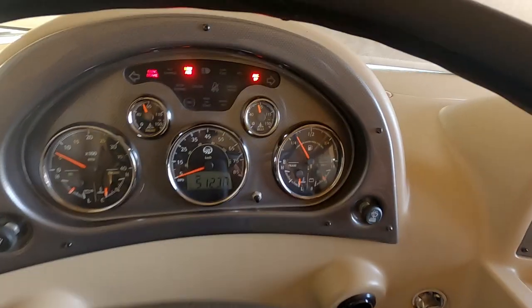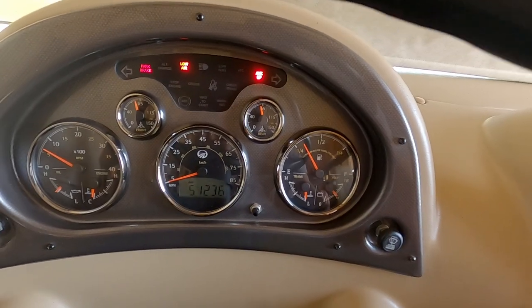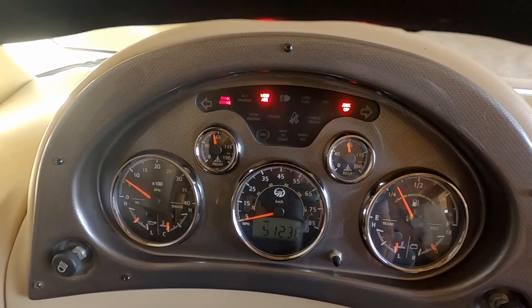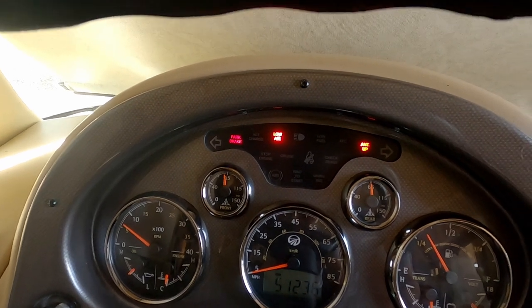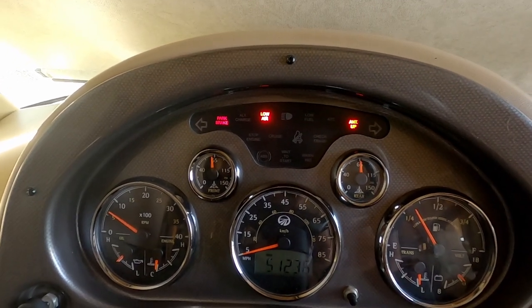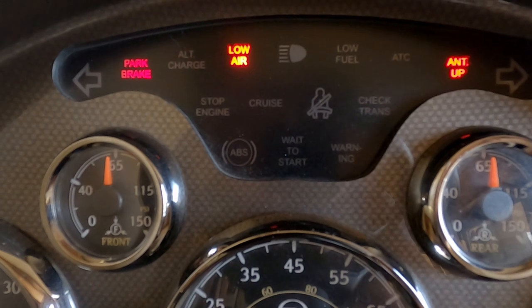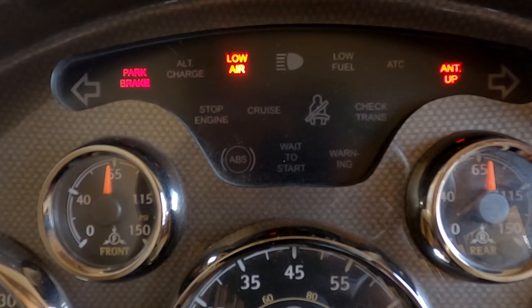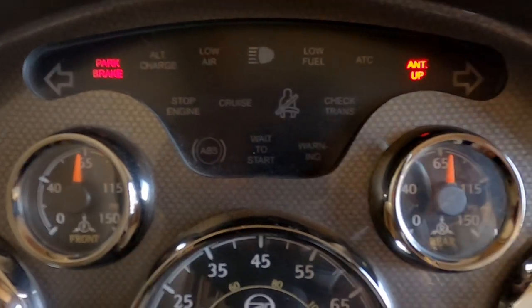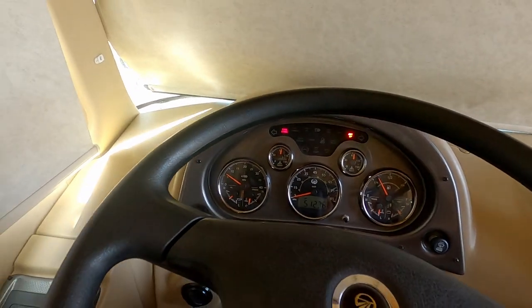Heat as well. You hear the little vacuum meter — all the vents are vacuum-operated and there's a little vacuum pump out front. We'll keep watching this — the air alarm does go off when it gets to around 60 to 65 PSI or a little bit more. There it went — we're at 66 or 67 on both. That'll go all the way up to 115 PSI.